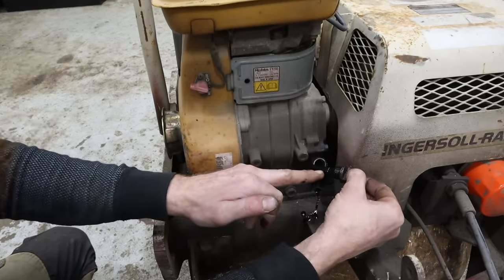It's kind of milky. It means there might be a little water in it. So, probably a good thing we did this. Yeah, there's some water in it, I can see some. So this filter housing here, it had this pipe thread just threaded in there. And the problem is, if I thread this all the way in, it literally blocks the oil passage. And I don't want that to accidentally happen.